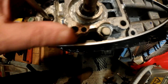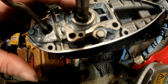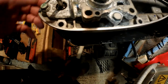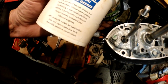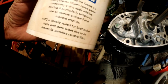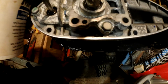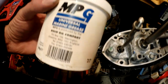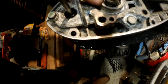It's been cleaned up with a brush and heavy corrosion taken away. I wouldn't start trying to sand it because as soon as you sand it you're taking metal away, so just brush away the worst of it. Now what you want is a half-decent marine grease — a waterproof grease. Not all greases are the same; if you get one that's not waterproof it'll mix with the water and go all foamy. Make sure you get a decent marine grease — this one is what I use and I've never had a problem with it.